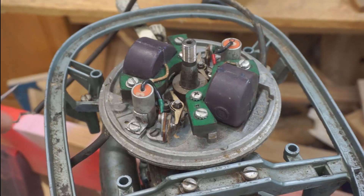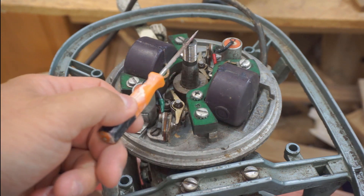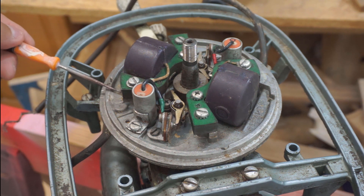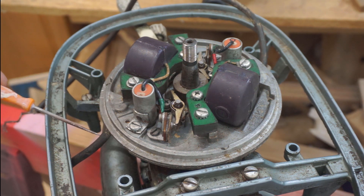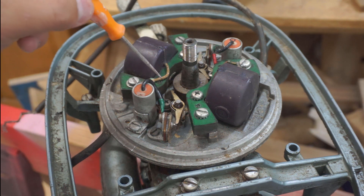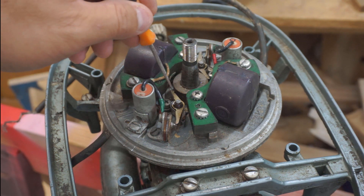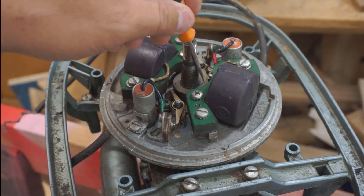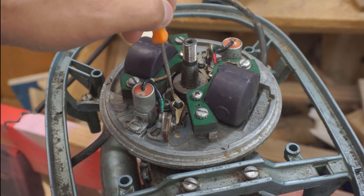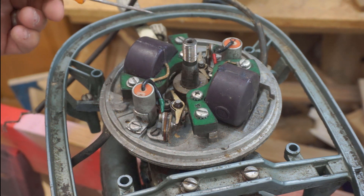So if you split this down the middle right here, you've got your two halves — cylinder 1 and cylinder 2. You've got your ignition coil. The spark plug wire connects right here — I'll give you a closer look in just a minute. It goes to cylinder 1. You've got your condenser, which is connected to your ignition coil and your points. Here's your point, and here's the rocker arm. When it hits top dead center, it opens it up. As this spins around, it opens each side here, and you've got the opposite on the other cylinder.